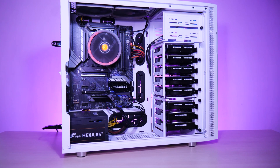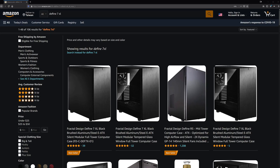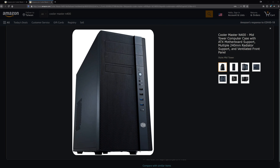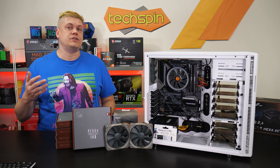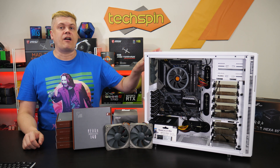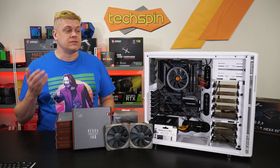What's going to contain your build? Finding a case for a media editing NAS can be tough. Fractal has a new Define 7XL that holds 16 drives if you grab sleds, and there's an optional glass side. The cheapest option by far is a Cooler Master N300 or N400, but drive access will be rough and there's no rubber mounts. There are also rack mounts, but those are usually too noisy for living spaces. We went with the Fractal Define R5 — coming just under $100 with 8 bays, shock mounts, and it looks great.